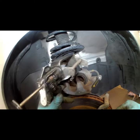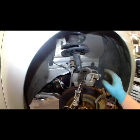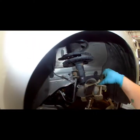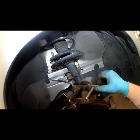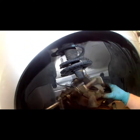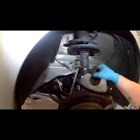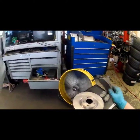Sorry about that — of course when I'm doing a video, you already know if you watch my channel, it's gonna happen. Let's push our piston back a little — the dust boot, just kind of push it in right there. I did that with the old brake pad. Just kind of trap your caliper up there on the spring.